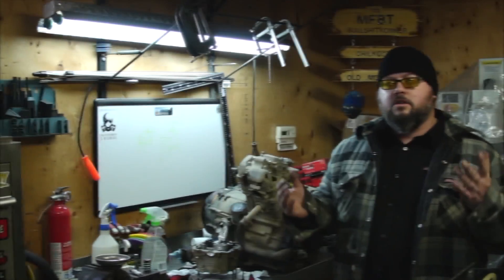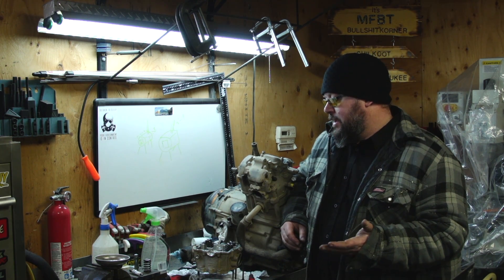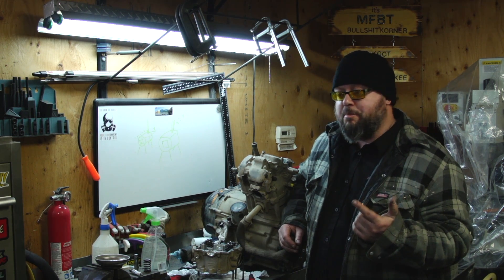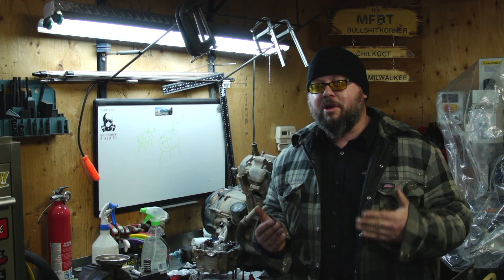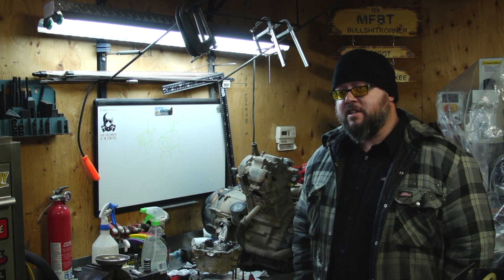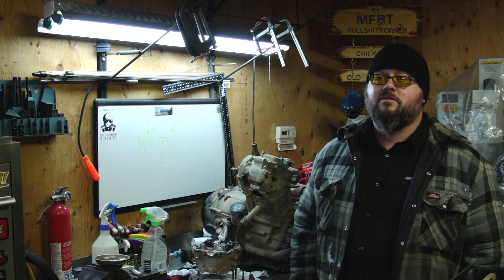Well, that was interesting. I really don't know at this point what to tell you guys — there could be numerous things wrong. Why is it leaking out the intake valves? It could be that the intake valves are bent, or they're so full of carbon that they're not seating properly. I won't know until I get it apart and have a look. Leave your comments below — we're going to get to this right away. If you have any questions or comments, post them below, and thanks for watching.